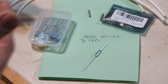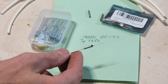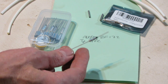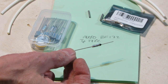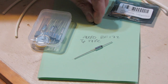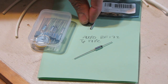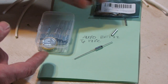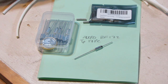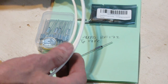In order for me to do this repair, I needed to get some things. I ordered a replacement fuse off Amazon. The original fuse in my Chefman was an AUPOBF172 - the 172 stands for the temperature range, 172 degrees Celsius. Since it is a high-temperature fuse, you just can't solder this. So I also had to get some thermal fuse crimps - they look like they're stainless steel. I was able to get a 10-pack of the fuses and the crimps from Amazon for about 15 to 16 bucks. I also need some heat shrink, which I picked up from my shop.